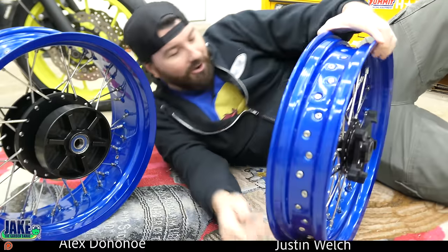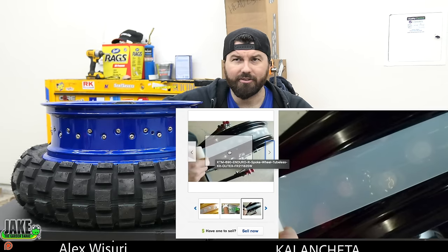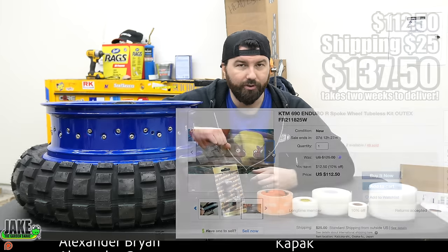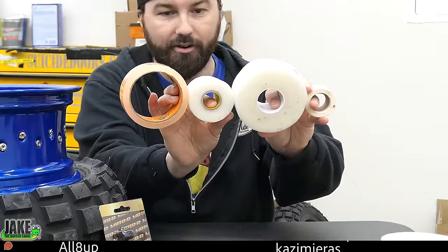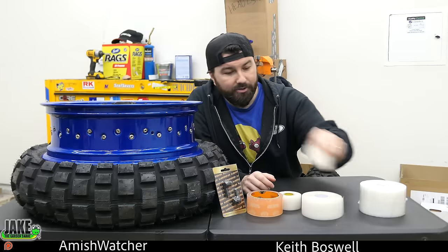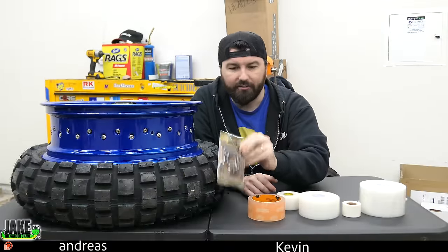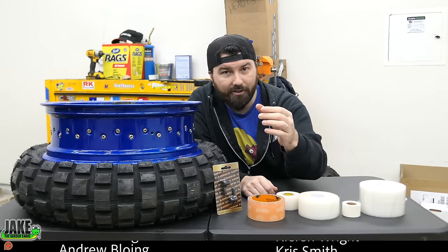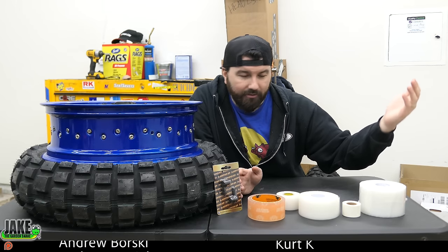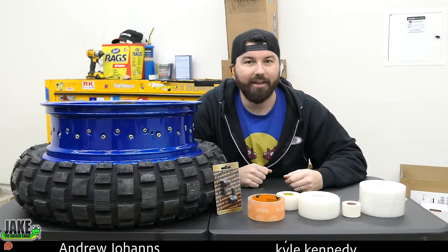How do you make them tubeless? You put glue on it? No, that's not what you do. If you look online there are some kits you can buy — I think it's like a hundred to a hundred fifty bucks. We did it ourselves last time using some tape. We'll be doing a combination of little stickers over the nipples, 3M extreme super mega sealing tape, then covering it with some Gorilla Crystal — just to protect it. Put the tire on, and you'll need some metal valve stems sized for the smaller diameter since this rim is meant for a tube. Normal valve stems are too thick. I put links to all the stuff in the description for that affiliate money — I'll make like two cents if you buy this.